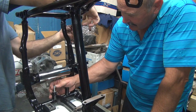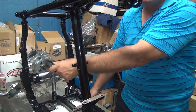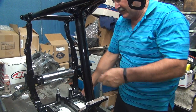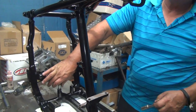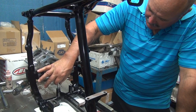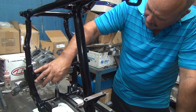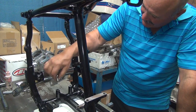Oh, that finally got tight. Okay, they're good then, when you cut the new thread. The new thread's good? Okay, so you gotta go down a half inch before it gets tight. Three quarters of an inch in. Now it's got some good threads. So we gotta put a long bolt in that hole. Isn't this frame ready to be put together? That's what the other shop said when they brought it over here, and I believed them too. You never believe anybody. You're always a naysayer. You mean it didn't bolt together? Typically people only put about that much in. So we go deeper. Would have been wobbly.